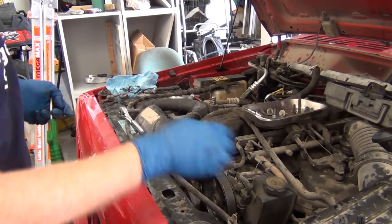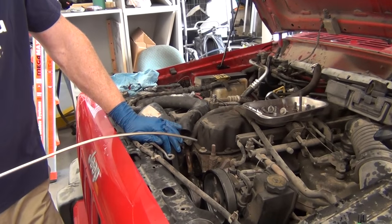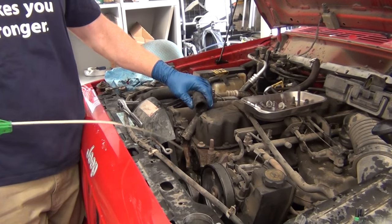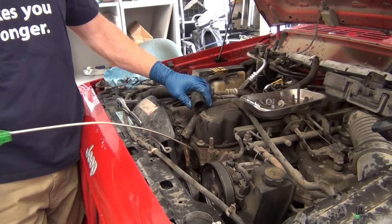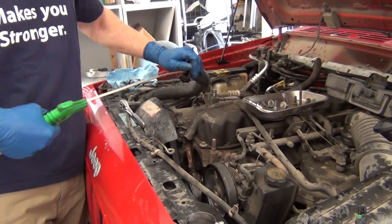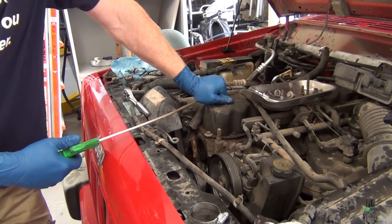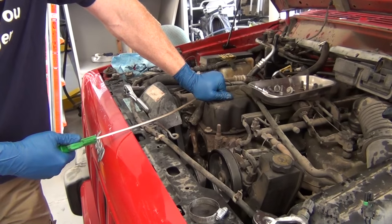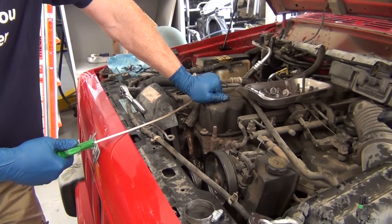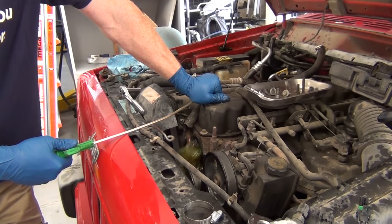What we're going to do is use some compressed air — but not here, because it just sprays everywhere, makes a big mess, and you breathe it. Nobody's got time for that. So we stick the air down the radiator hose, pinch it off, and watch — we've got a drain pan fit to catch it underneath. Blow a little, and just like turning on a tap, nice and controlled, we blow the coolant out of the engine.